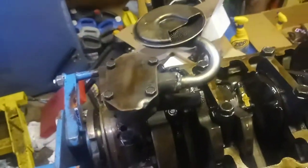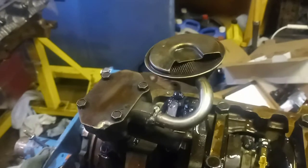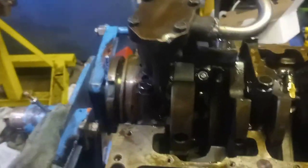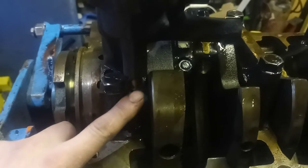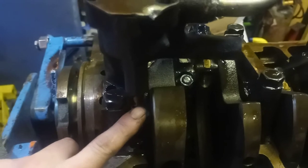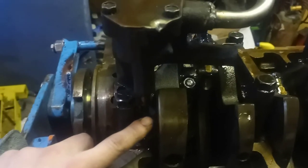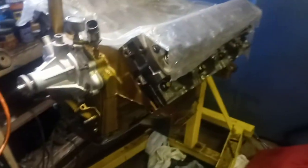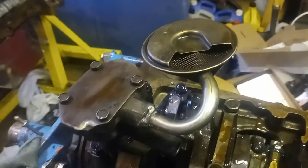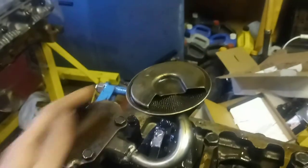The second thing with an Olds: if you go high volume pump, you have to go with a bigger pan. A high volume pump is 150 bucks, a pan is another 150 bucks. Olds uses a drive shaft for the oil pump, like a Ford. On Fords — like the factory high output motors — they were known to twist off the drive shaft. So if you're putting a high volume pump in a Ford or an Olds, get the hardened shaft. I think Moroso makes them — it's stronger and you won't twist it off. That's what I have in my 488. So it's not just adding a high volume pump; it's having all the other issues to go with it: high volume pump, a different pickup, eight quart pan, hardened drive shaft.